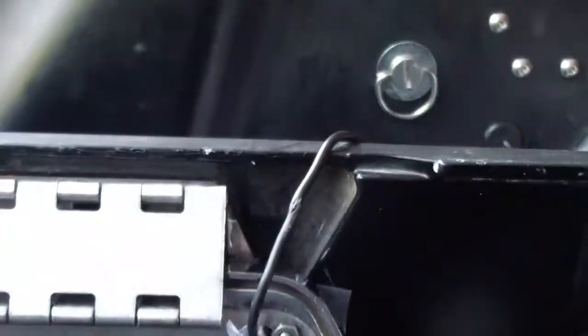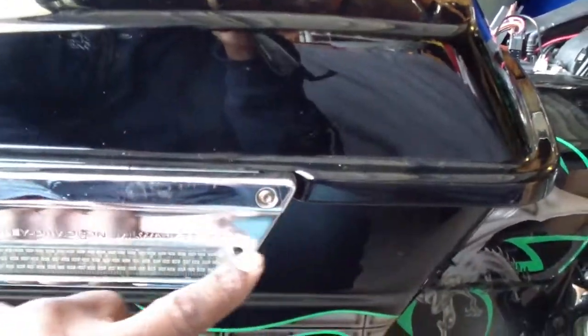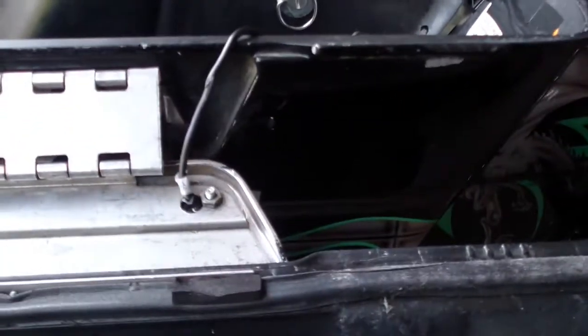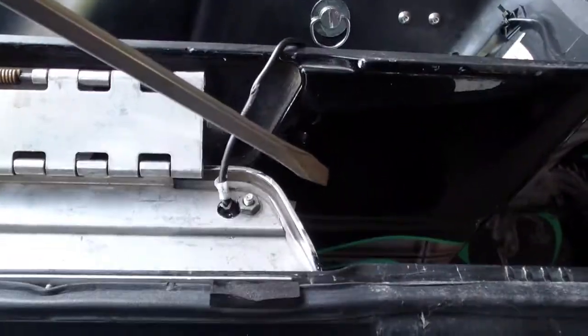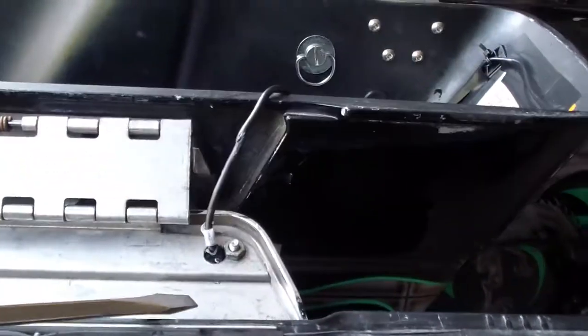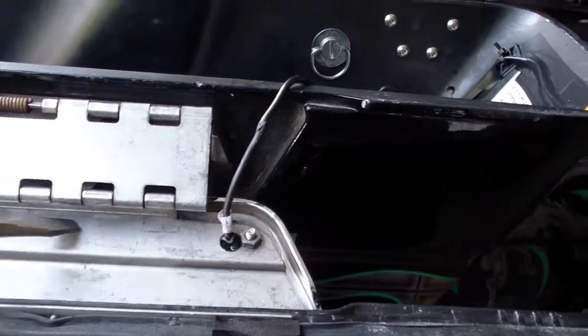and you have to remove these two nuts, these two here, and one here. It's the only way you can get this latch off. And not only that, you have to drill two holes. One 3/8 hole in the latch cover, and then another one in the plate here. See, that's another 3/8 inch hole so that it comes through, because this attaches to that.